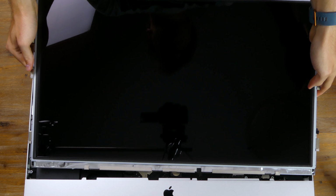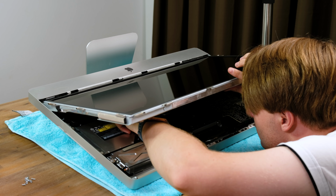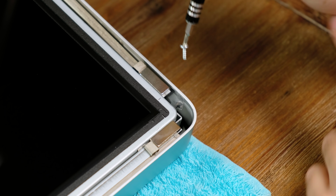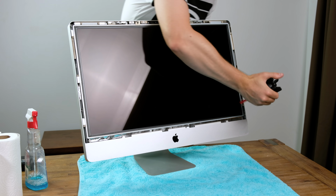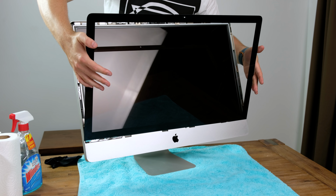With the SATA and power connectors attached, I carefully slotted the display back in place. I made sure to reattach all of the connectors to the power supply and logic board. The screws holding the display in place were a little tricky to put back in. With the display panel securely back in the chassis, I gave the exposed surface a dust with an air blower to ensure that it was spotless.